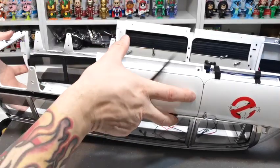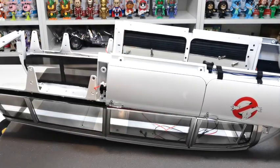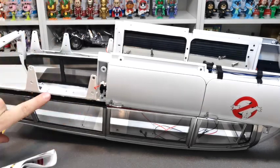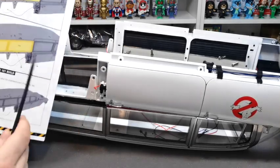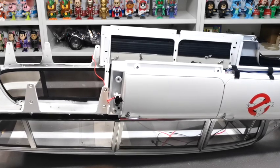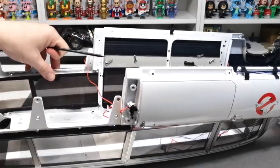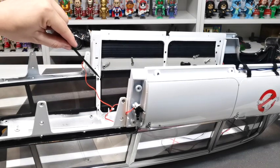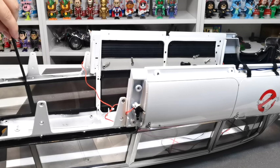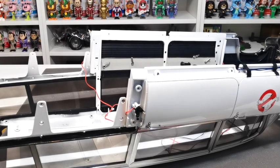I want to show you this angle — it's really important we get these right. I'll bring the magazine over so we can have a look. On the outside the VM screws go along the outer side — one, two, three screws. On the inside you want AP, AP, AP and two VP screws. The VP screws go there, and there is one down at the bottom. On this side AP screws go in down here, just up the top, and in the lower corner is another AP screw. That is how that window frame is held on.